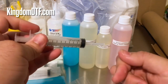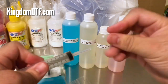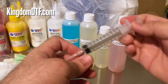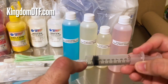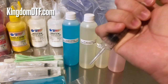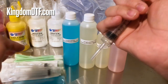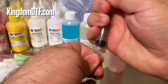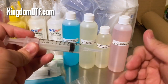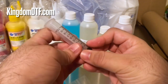Be patient when it comes to flushing or cleaning printheads. If you use too much force on that nozzle, you can blow the nozzles inside — and that's something you won't see right away. You'll know you blew your nozzle when the printhead starts giving you problems. When putting in cleaning solution, use maybe 1 to 2 ml, push really slowly without pushing too hard, because you can damage your printhead. Many people have heard this advice but do it too hard anyway and end up with a damaged printhead.